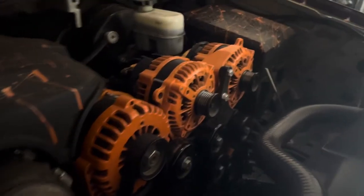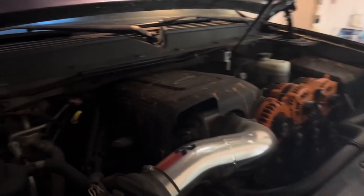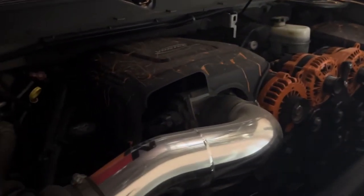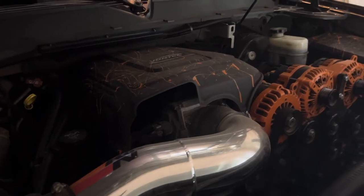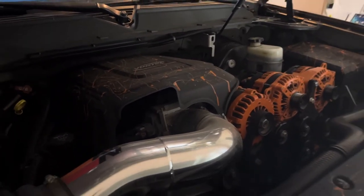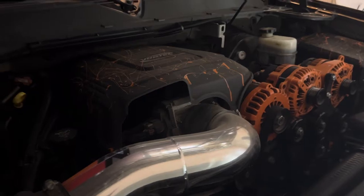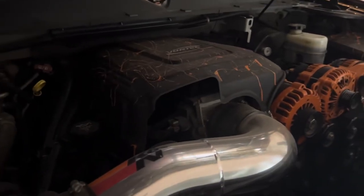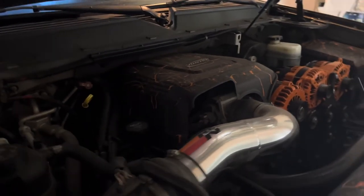And the biggest common issue is up front with the alternators, because you have dedicated grounds within the truck itself in the front on the engine. And a lot of people, when they set up their system, put grounds at other locations. So for the guys that wire up their system to their truck, to the factory, the best thing is to try to put your ground in the same exact location. Even when you're doing a big three, try to keep your grounds in the same exact location. Don't put them anywhere else, because it ties in with the factory system, right?